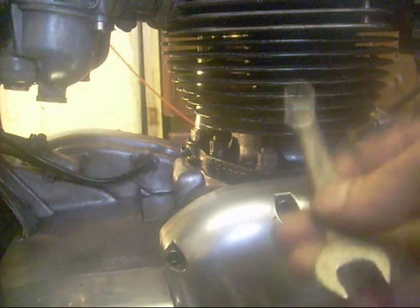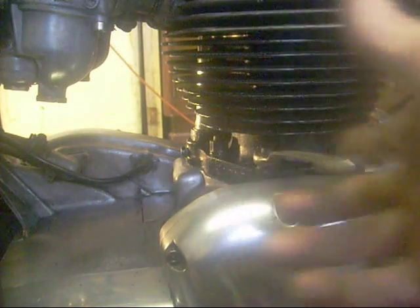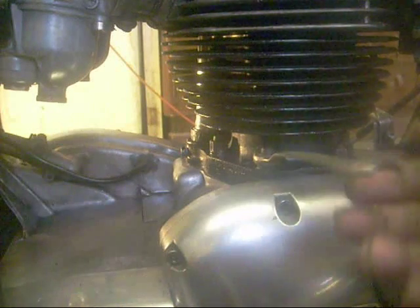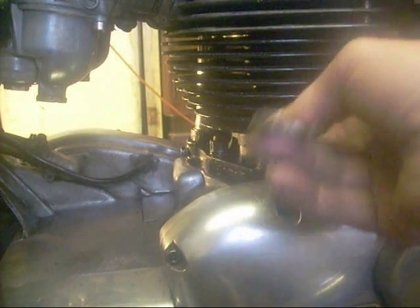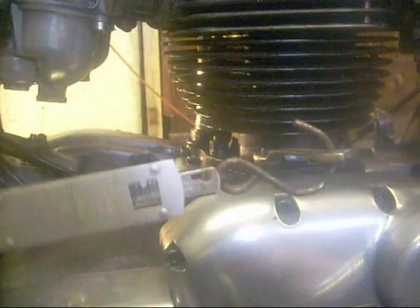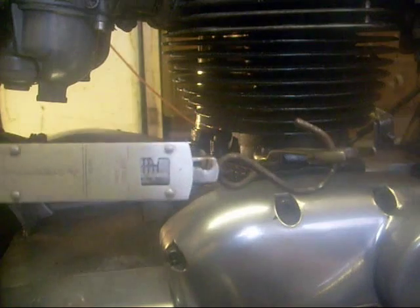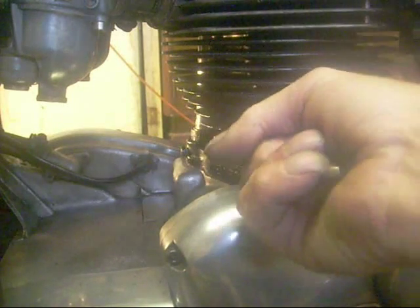The question on a forum was: how do you torque these up? Well, personally I never use a torque wrench, I always do it by hand. But the only way you could do it really is make your spanner, or buy spanners that are a foot long - twelve inches long - and a spring balance, and literally hook the spring balance on and pull at right angles till you get the poundage required. And that's torqued up. But personally I just do them up by hand.